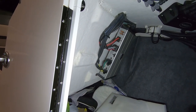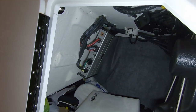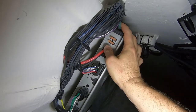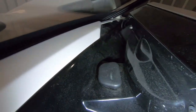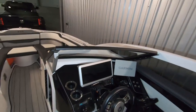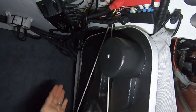Speaking of the amplifier, many Yamaha owners probably know that with no music playing you get white noise from all speakers — the amplifier is connected to ignition and powers up a couple seconds after you turn the key. My dealer spliced the power wire — the blue wire — and ran it to a switch located right here behind the original display, so I can manually disconnect the amplifier when not listening to music. That takes care of that white noise issue.